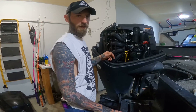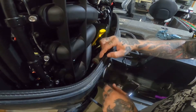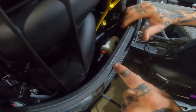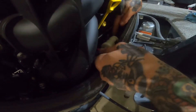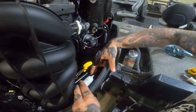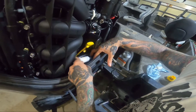It's also probably a good idea to change your fuel filter. It's a few simple steps and no tools are really needed. Here's your filter right here — you'll see this little quick connect, so you just squeeze it in and the line pops right off, and then this rear one pops out just like that. Then you take your new fuel filter and put it in the same way the old one came out.